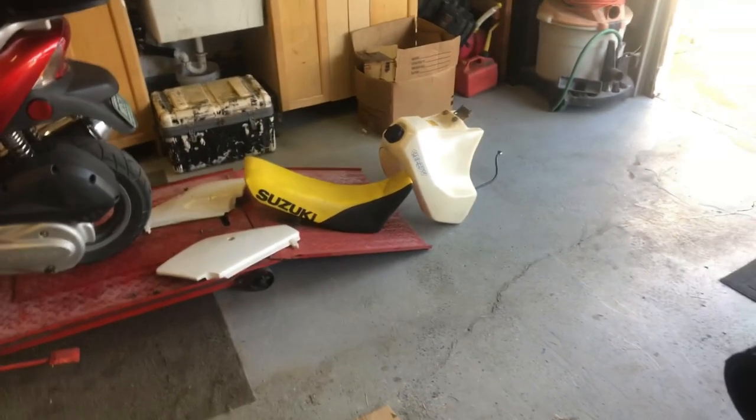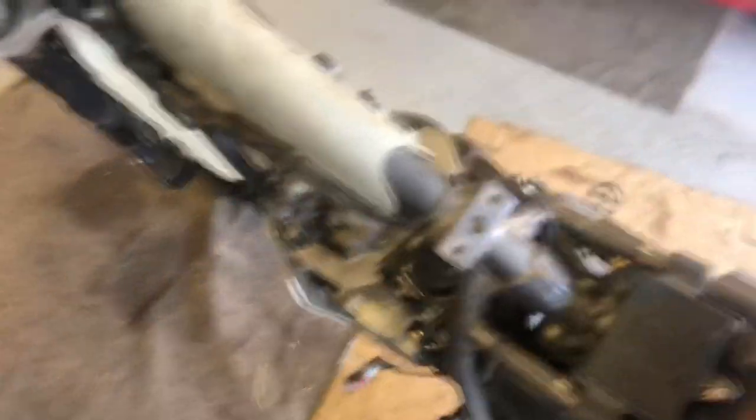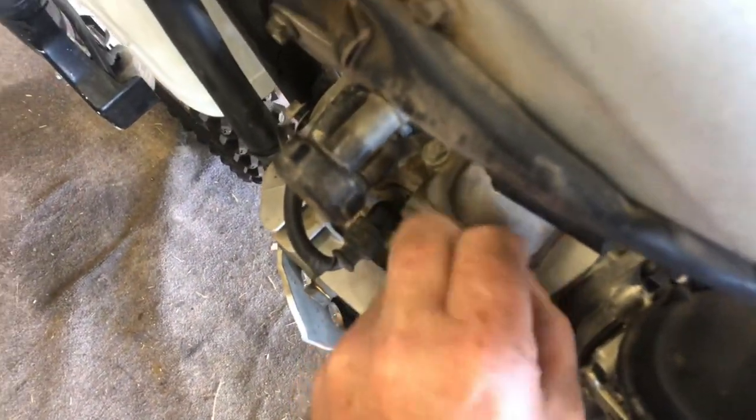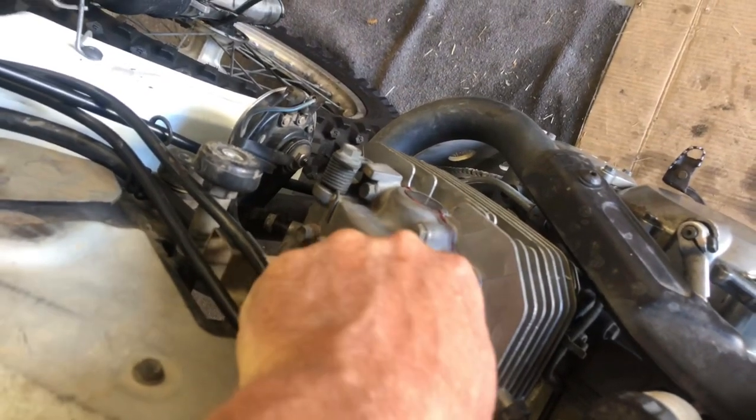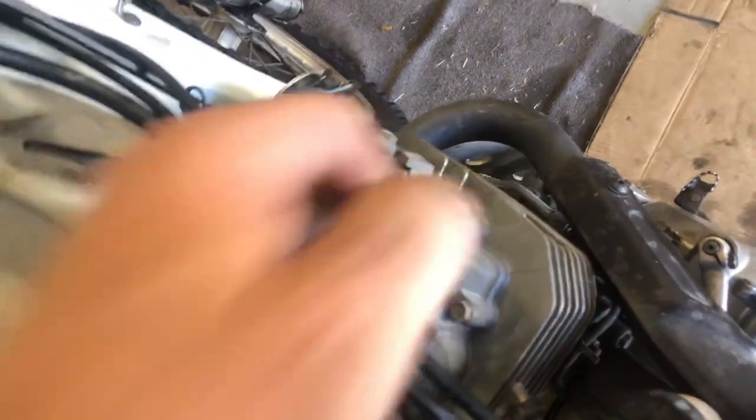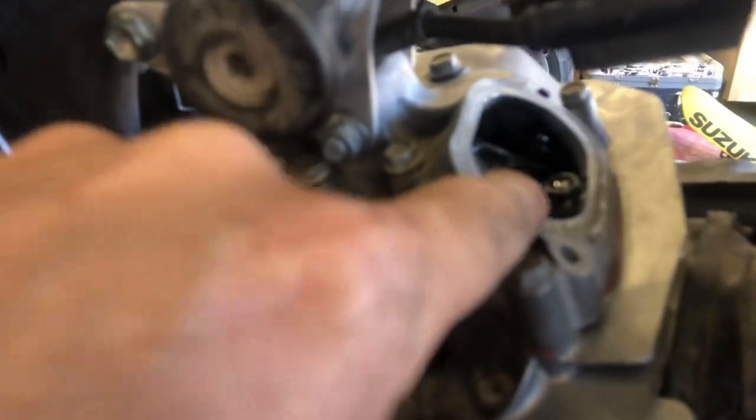Okay, there's your basic pile of parts as you start stripping her down, and we have access to the top of the engine. I've already loosened up these cam cover bolts. A lot of your old air-cooled singles from the 70s, 80s, 90s — even today, the DR650 and the XR650 made to this very day — have a very similar system to this. Get to the top of the engine, remove a couple bolts, slide off your inspection cover and you're inside. We are going to check our valve clearance, and if that seems normal we are going to pull this cam cover off and see if we see anything obviously wrong.